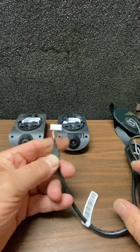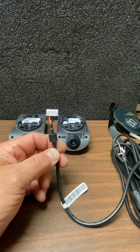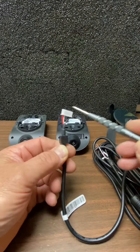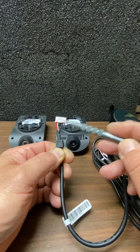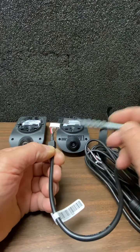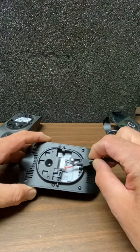The harnesses on the N2 and the N3 are compatible as long as the N2 has been powered to ignition — that was a red wire. As you can see, the plug is the same. One side has nothing on the back of it. The side that's going to go up has these two little bosses on it. Just remember, the boss is always on top — so there are your two bosses.